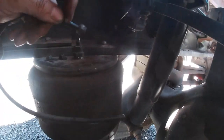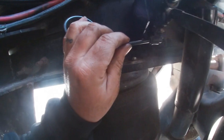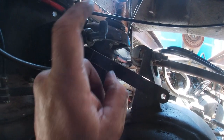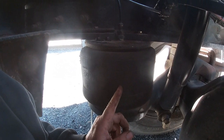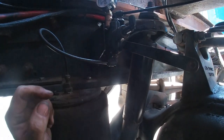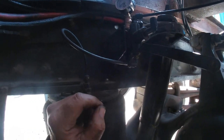If the rod goes over, if the rod's down, it will dump air out of this exhaust valve back here — that's the exhaust part of the valve. You have a line that went from the bag to the valve, then another line on the port — C1 and C2 — and then this one here is your dump valve. If you want to dump your bags, you hit the switch on the dashboard and it sends air to this, pushes a plunger over to the exhaust valve, and dumps the air.